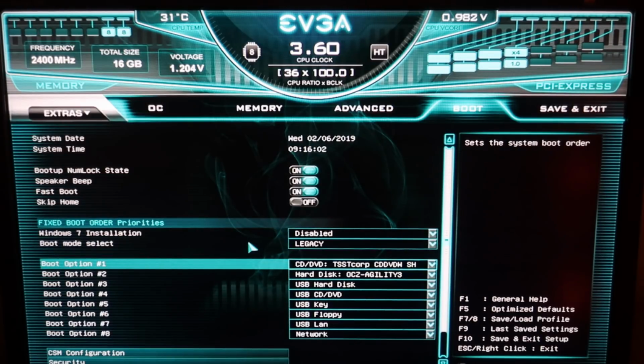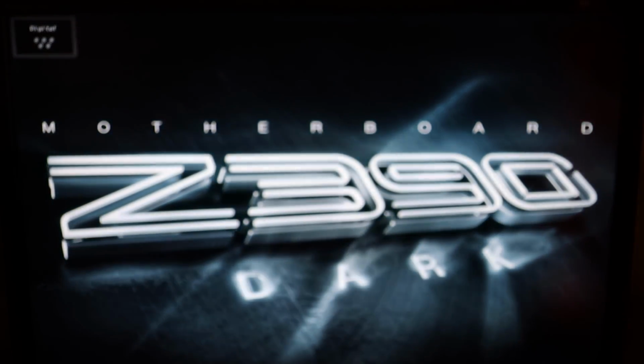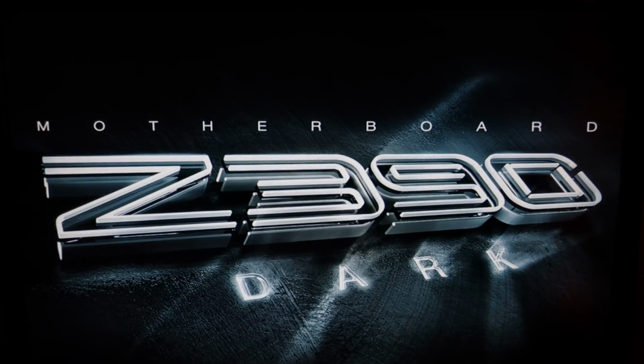Then we just have to put the CD or DVD drive as boot option 1 instead of the actual hard drive, and then we can just press F10 and restart the system. It will now ask to press any key to boot from the CD. It will go through all the major components for the actual installation process.